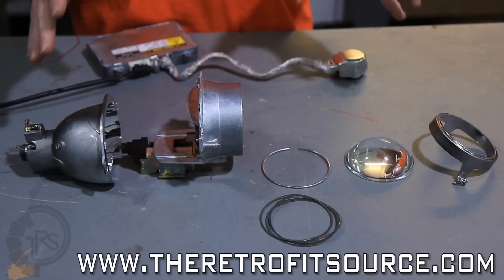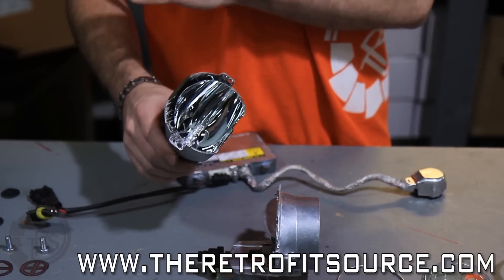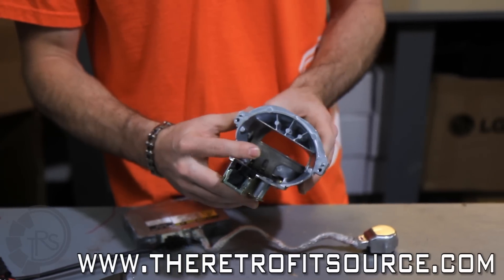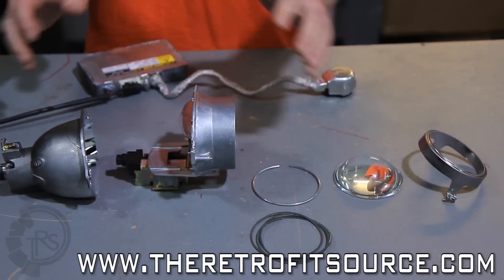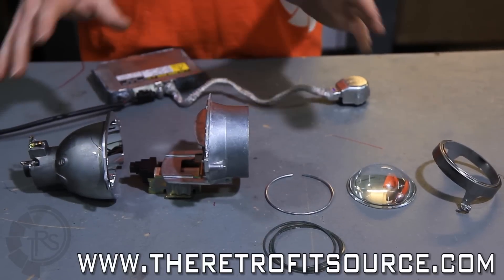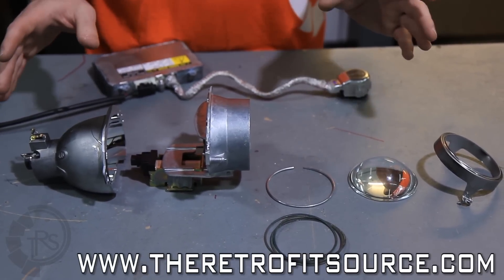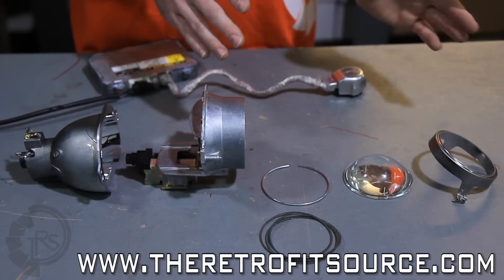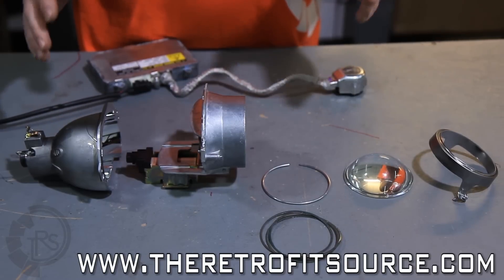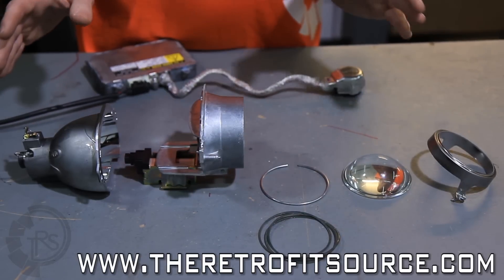When setting up the clear lens, there are three main parts of the projector to consider. The first is the capsule of the bulb, which is the light-emitting element and its position inside the reflector. The second part is the actual cutoff shield of the projector, which is the shield inside that makes the beam pattern. And the third thing is, of course, the lens itself. The spacing between these three elements is pretty crucial in getting the right beam pattern. Because of the high tolerances and sensitivity of the optics inside projectors, you can space out clear lenses in a variety of ways to adjust the light output — getting a little more color and less sharpness, a little more sharpness and less color, or right in between. It's kind of personal preference once you get it all together.